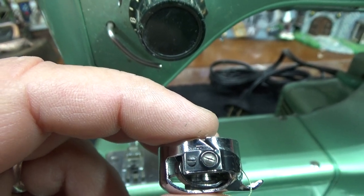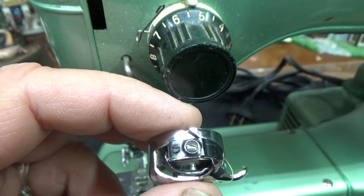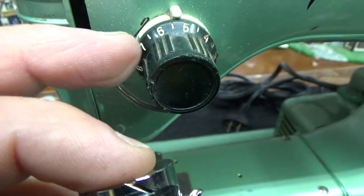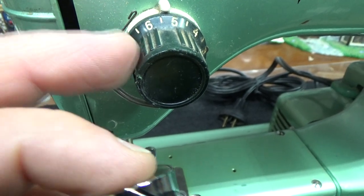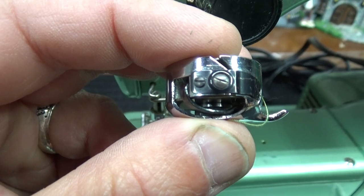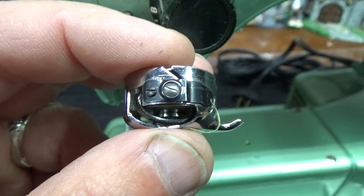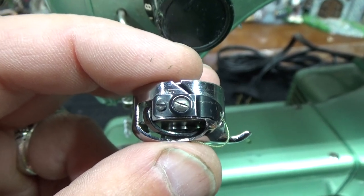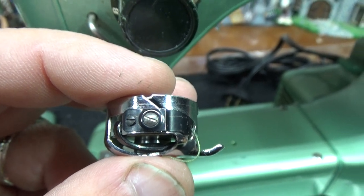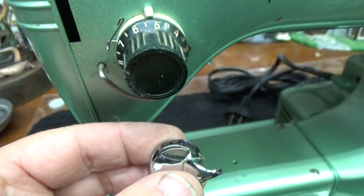Run another sew off. Okay, it's starting to look better. And we're all doing this hypothetically. It's starting to look better, but still not quite there. So we're going to leave this alone, because that's about the range that we want to be in, between 5 to 6. So we're going to turn that screw that's on the right another 2 millimeters. You do another sew off. Oh my goodness gravy. We've hit pay dirt. The lock stitch looks phenomenal. The top stitch is still perfectly defined. We've hit that magical sweet spot.